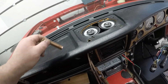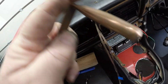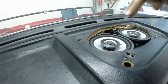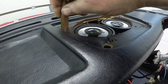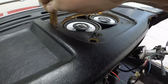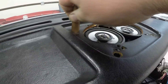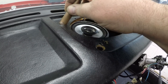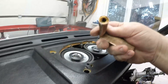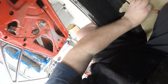I'm back for the second hole. I actually took this back to the drill and gave it another little sharpen up with the countersink bit, so we'll see if it's a bit more effective — it definitely lost its edge, it's only copper. You just locate it around the centre of the hole, twist it, and there you go — it's gone through the vinyl. A few more twists and there's a nice neat hole. Remove that bit out of there and on to the last one.